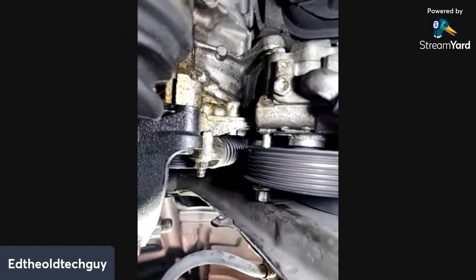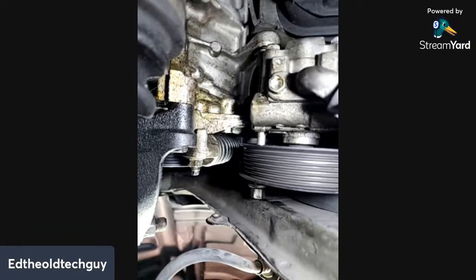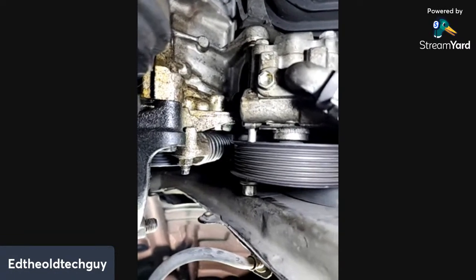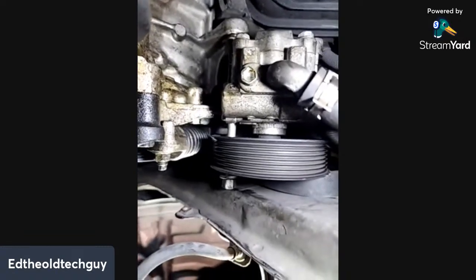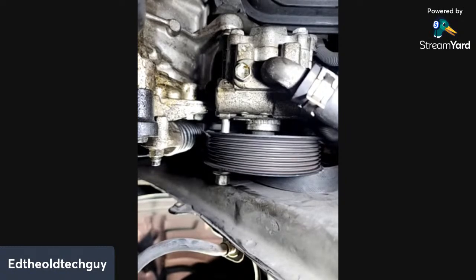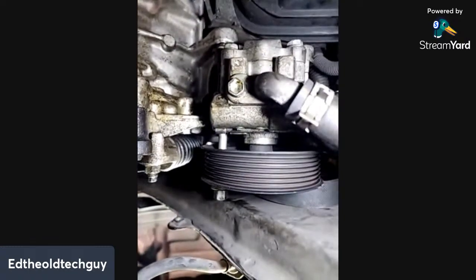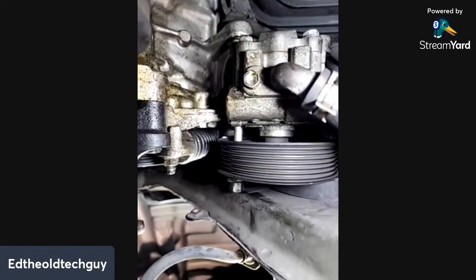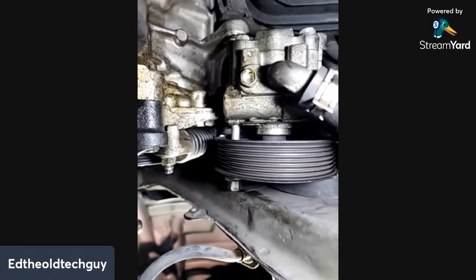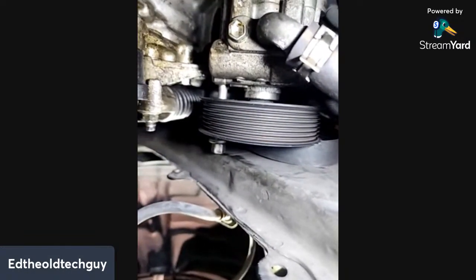All right. Well, you see the pulley a little bit to the left. You've got that cylinder-looking piece, the 10 millimeter holding that hose. Right behind that, underneath it, is the dang Allen for that screen to collect any gunk in the oil. According to what I understand, you'll be able to swing this out. It's either that or you have to take out the whole power steering pump. But the fun part is I can't take out the power steering pump because I can't even get this bolt out of the way. I'm hitting the firewall right there. So I've got a couple options.